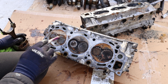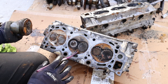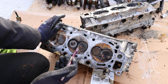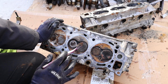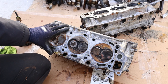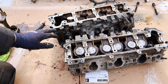Taking a look at this head you can see there's a lot of crusties from the head gasket failure. There are no bent valves in here - this is a non-interference engine, so if the timing belt snaps the piston doesn't risk colliding with the valve because the valve doesn't open enough to touch it. You can just put a new timing belt kit on and it'll keep running. One of the downsides to this engine is that it only has two valves per cylinder, which is why it's got the nickname 'three-point-slow' - it only produces about 150 horsepower and 180 lb-ft of torque, which isn't much with big wheels on your 4Runner or Tacoma. With only two valves you're really limited in airflow, so even supercharging, turbocharging, or just putting a proper intake and exhaust on it is restricted. At the top it's just a cam bucket design with no lifter, rocker arms, or hydraulically adjustable arms - you adjust valve clearances the old school way by replacing these parts and shimming them up.